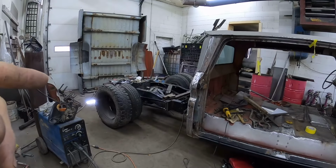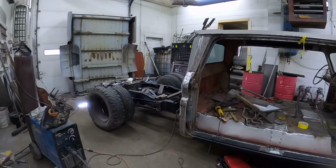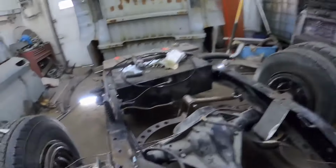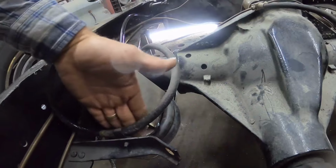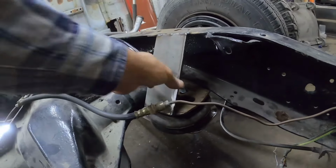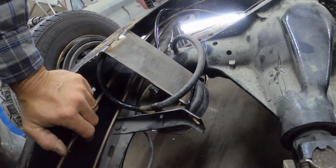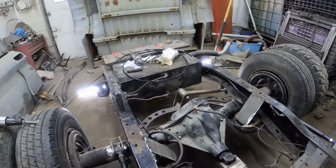Yeah, all right, well, I'm going to probably go ahead and get them bags unbolted, and then I'll lift it up, get that out of the way. I got to move them holes forward 1 inch. I think I'm going to change this because it's too much of a pain in the butt to get to that front bolt. I think I'll put a gusset right here and here on both of them. That way the top of the plate is all open. I think that'll work a little bit better for me. Other than that, I think everything is good to go.